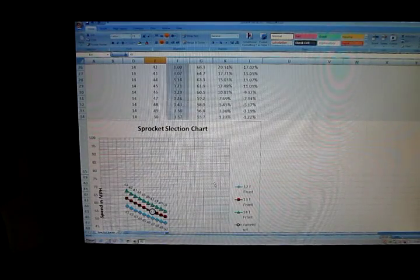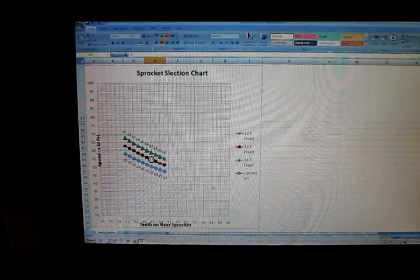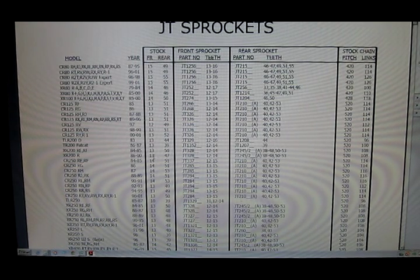You can download this chart free on my website at MotorcycleNut.com — there's a link in the description and in the iCards. Also on my website I have a JT sprockets catalog. It shows the stock front and rear sprockets and also the other available sprockets you can buy from this company. It also shows the chain and chain length. For example, an XR200R from '86 to 2000 is listed as 13/47, and the available sprockets are a 12 and a 14 in front, plus the available rear sprockets.